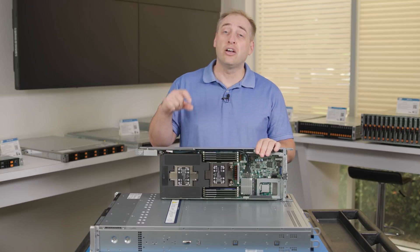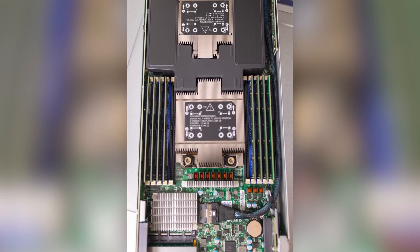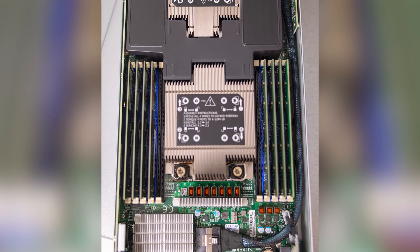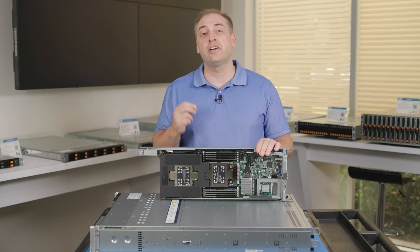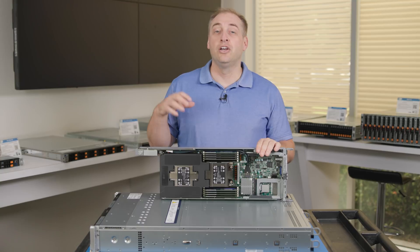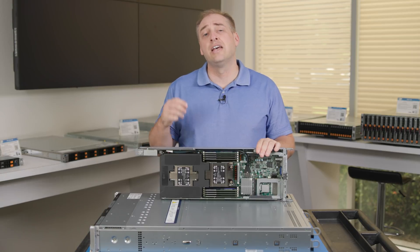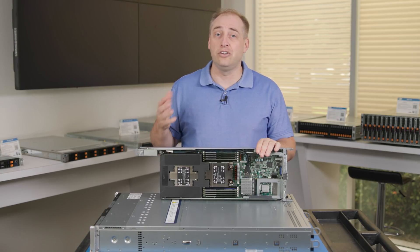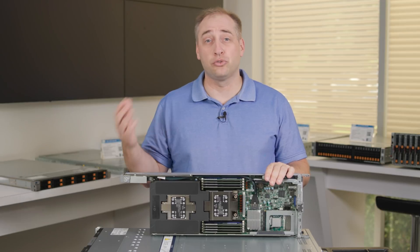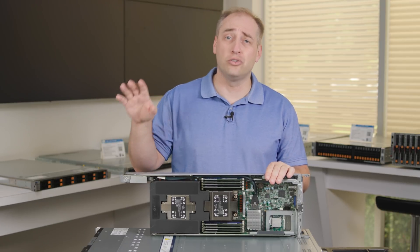Because of the thinner power supplies and wider tray and motherboard design, we're not limited to eight memory slots per CPU. We actually get two additional slots per CPU, and those two extra slots can be used with Intel Optane Persistent Memory 200 Series — PMem 200 — to add persistent non-volatile memory to the system. You can use that either as memory expansion or as high-speed persistent memory in the DDR4 slots. STH has an entire video on Optane DC Persistent Memory modes, linked in the description.